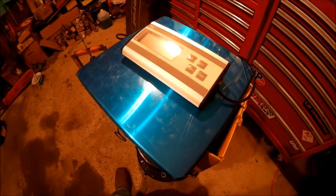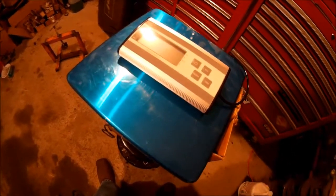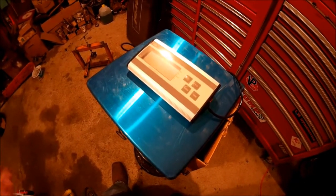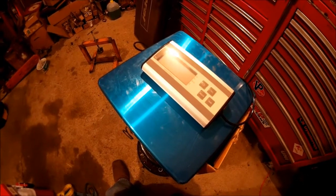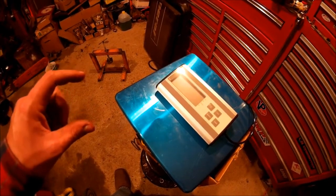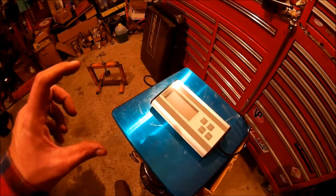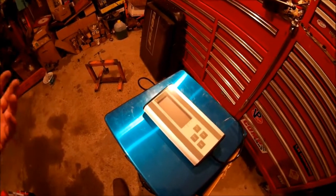The main portion of this whole build is the scale, and this is actually an Amazon special — about $35. It's more of a postage weight type scale but it's good for up to 400 pounds, so it can handle a pretty hefty amount of pressure when testing springs. Most springs in the Polaris and Comet clutches don't even go up that high. If you get into TRA type springs that can get over 400 pounds, you can start compressing the spring, deflect it down an inch, and do some calculations to figure out the spring rate. Once you do that, you can find your starting point pressure and since you've already calculated the rate, figure out where it'll be at the end without putting 480 pounds of force onto the scale.